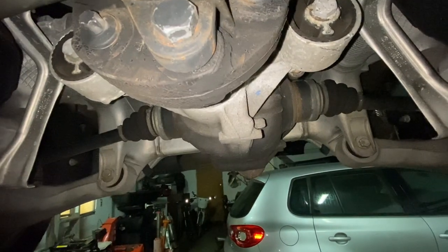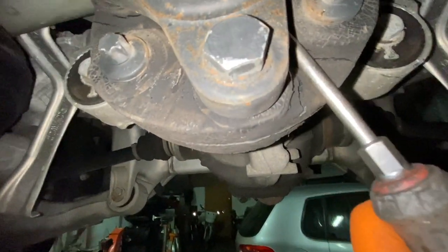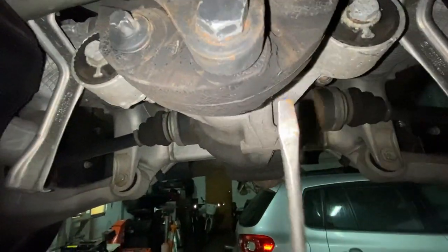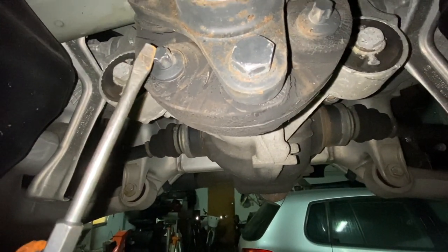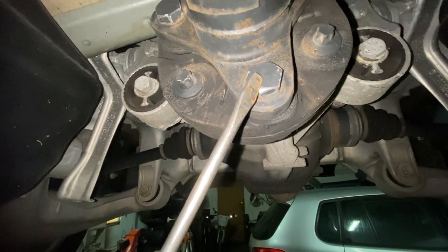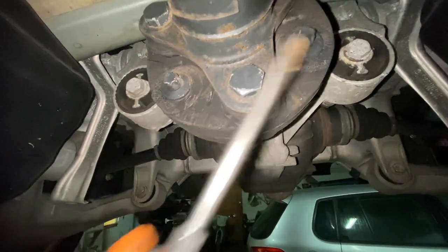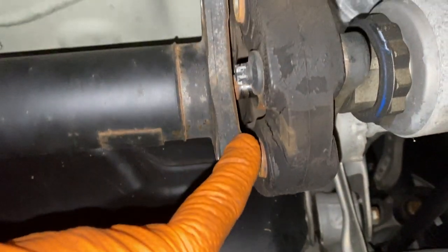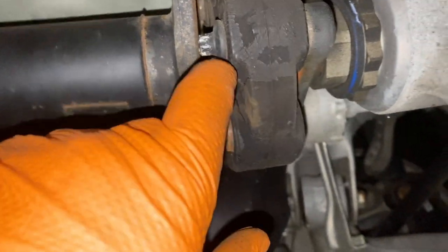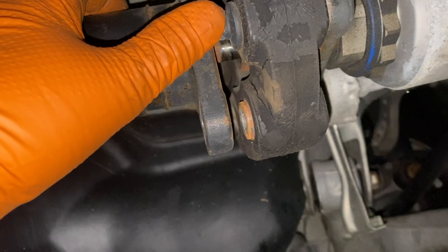You see these cracks here? You can see it — that's getting ready to rip right out, so take it out. This is an E12 inverted torx and this is 18-millimeter. You could take either one off but you've got to take both off to get the driveshaft out. You might as well take the E12s out on three sides. Once you have them loose, you can't really take off the flex disc — this rubber disc — unless you take off these bolts. You have to take them off to get it off.